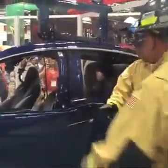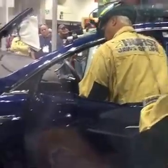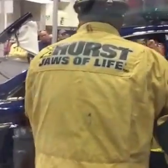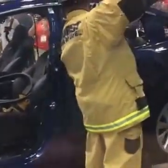The latch system and the hinging on the Model X is what we're used to seeing in conventional vehicles. The difference is that it's aluminum construction on the skin and most of the body structure, so we're not going to see traditional ripping and tearing with steel — we're going to see a lot more breaking of the aluminum. The front doors cannot be opened without 12-volt power from the outside, so that could create a unique situation. There's no mechanical linkage from the outside, but like all vehicles with electric door latches, the Model X is equipped with mechanical linkage on the inside. As a rescuer, we can reach inside and utilize the inner door handle to use that mechanical linkage.